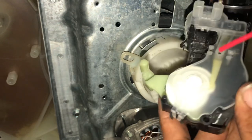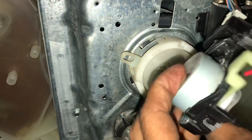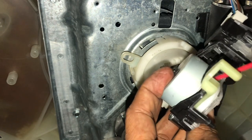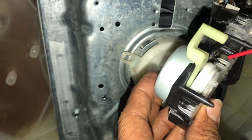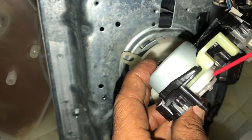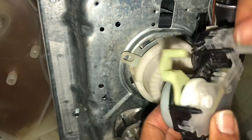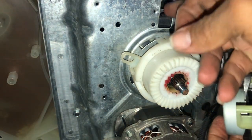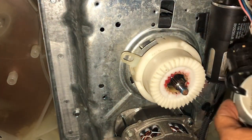Guys, it does not hurt, just with a tad, not a lot, okay? This is a little wheel, they can seize up, so a slight bit of lubrication does not hurt them at all, keeps moisture out of them. Not a lot, a little goes a long way. Keep this part clean. That's where the eye is. It reads and lets the computer know where the drum is, its location and speed.